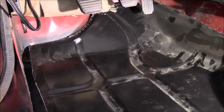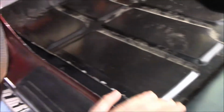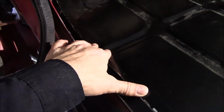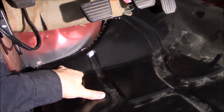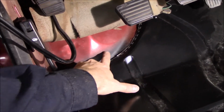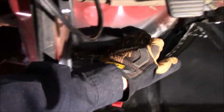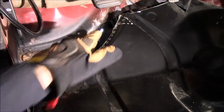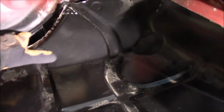All right, near as I can figure, the disconnect is in one little detail. You see here, it fits pretty fine. It's kind of lining up with the stampings. I mean, I can massage that a little bit more. There's a stamping in there it lines up with. But they were intending to go up here with their flange that I cut off. They wanted to tack to here. So they're counting on a lot of this being rotten out, and they're wanting to go up to here. So you're cutting past the original joint and putting it up to there. Which I could do, but I'd rather have it sitting on this joint.